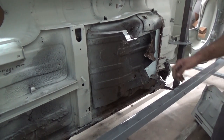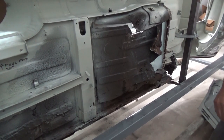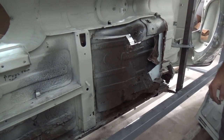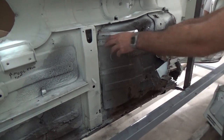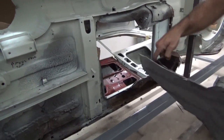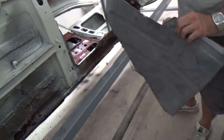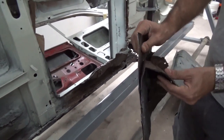Now look at that mess. Finally with the car vertical we can start removing the old floor pans. I used a combination of cutting discs on a grinder and spot weld drills to remove the spot welds over here. As you can see there was a lot of previous repairs — there's about three layers of sheet in there, so when the holes started to appear they just kept on adding new panels to keep the water out.